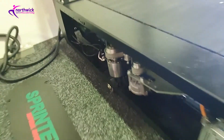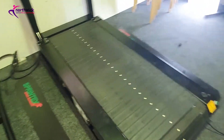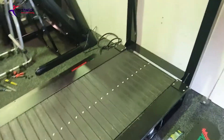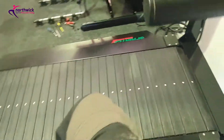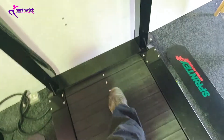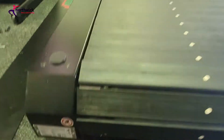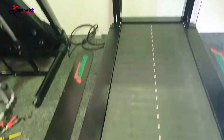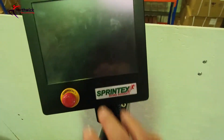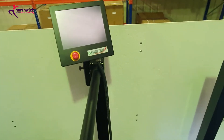In terms of your feedback, make sure it's very concise and accurate. You need information like your PAT test results, motor current test, and you can do a stomp test just as you would on any other machine. A shuffle test can also be done and recorded. The serial number on this machine is at the back - make sure you record all of that.